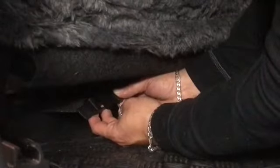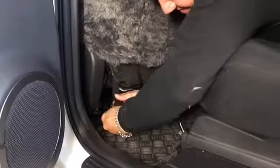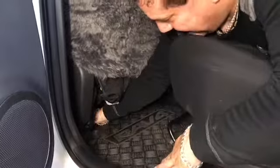Now we're behind the seat, which is maybe a little bit easier to get the one on the inside of the seat fed through. You've got the clip from the left hand side and the clip from the right hand side ready to meet up in the middle. Get the clips to meet in the middle at the underside of the seat and once you've clipped it together, you should be able to pull it tight. Pull through the one from the front, the one that's come through the back part of the seat, clip them together, and tie it off nice and tight — that one should be hidden underneath the seat.